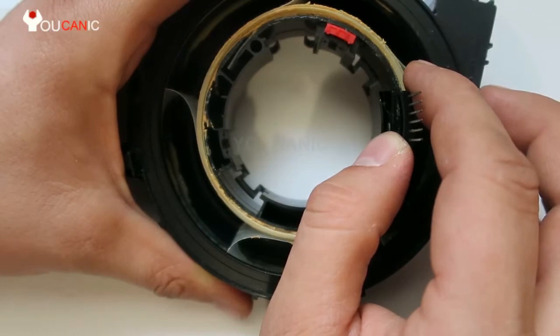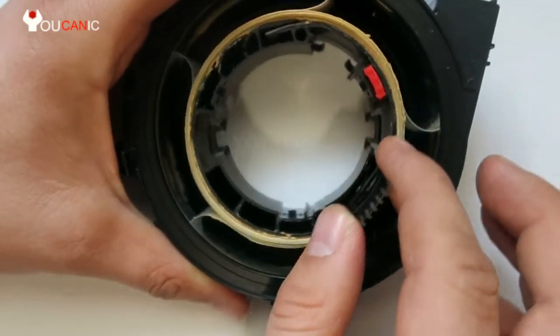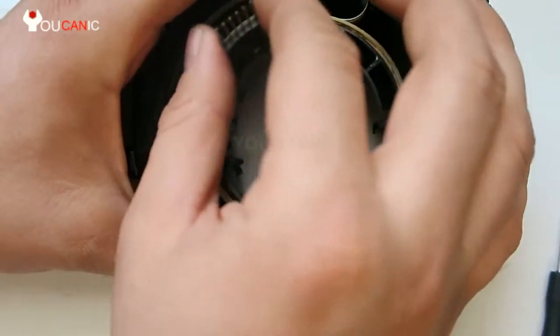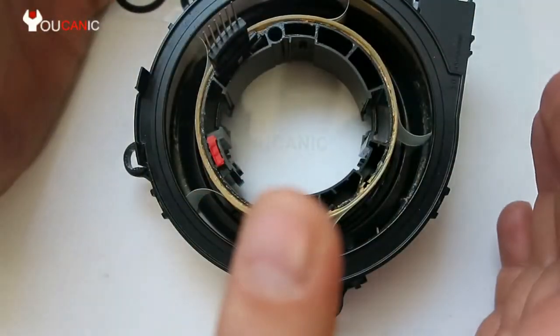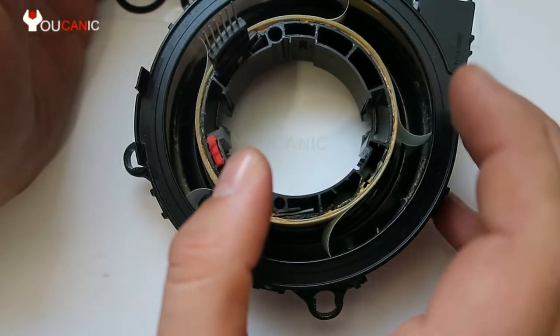So what we're going to do is go about two and a half turns back from the stop — that should be the center for this clock spring. That's half, one, two — right there. You might have to adjust slightly when you line up your steering wheel, but that should be the center.